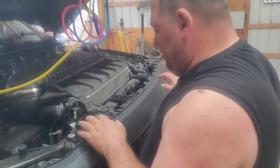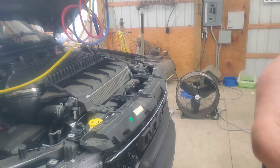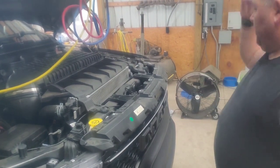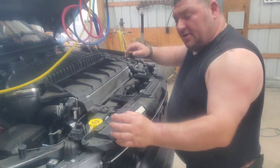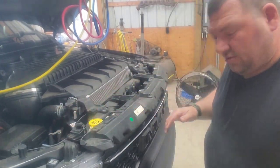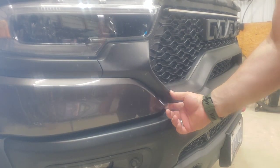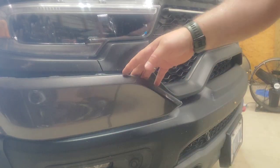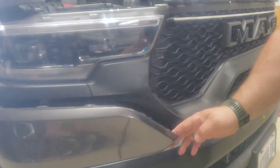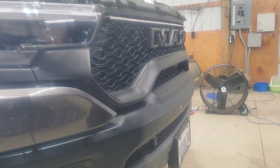I got all the screws out on the front edge and this piece slides up as well. Now with all the top grill bolts out, if you lift it up there's a little detent it's sitting in. The seemingly worst part is these pieces right here — it seems like you're gonna break it, but there are screws behind there. You just grab it and pull it off, then you have three screws on each side, 10mm, and this will come off. Do the same for the other side.